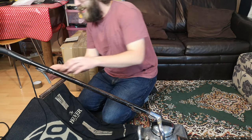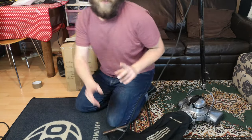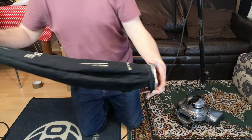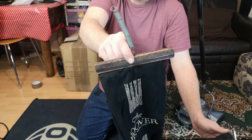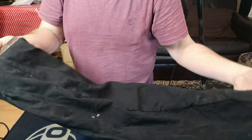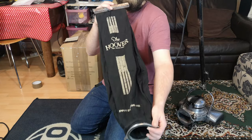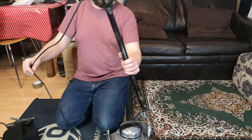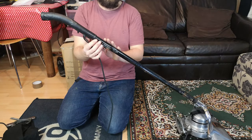Now, the bag. Let's take it off. This is the bag that came with the machine - or not. To take the bag off is lovely: down here you just turn these half a turn and off comes the bag. This is the second best of the three bags that I have. Can't remember which one came with this machine because they all sit together. This may not even be the correct bag holder - this is one that I found. Sadly, this is the bag which is just falling apart. This could be from the 700 and be even older. It's not the worst and it's not the best - it's just good enough for a photograph. The handle still has its original wiring in it, which was pretty good actually, so I left it in there. The reason it was probably pretty good is I think it's not the original handle, because these should be two-speed and off.